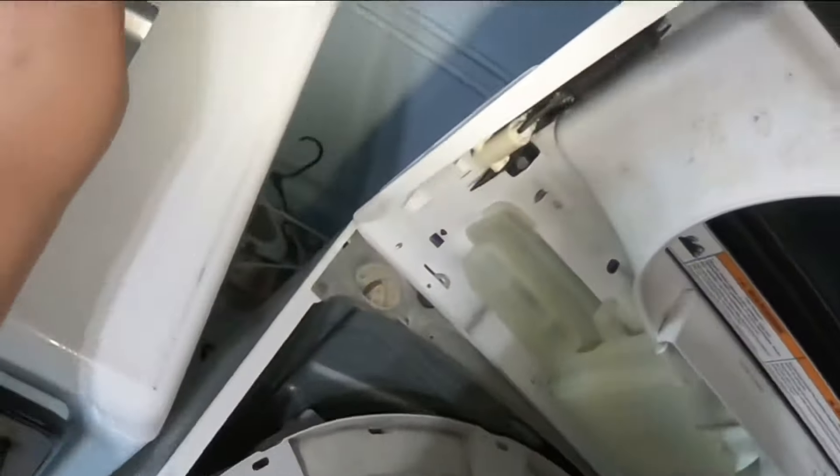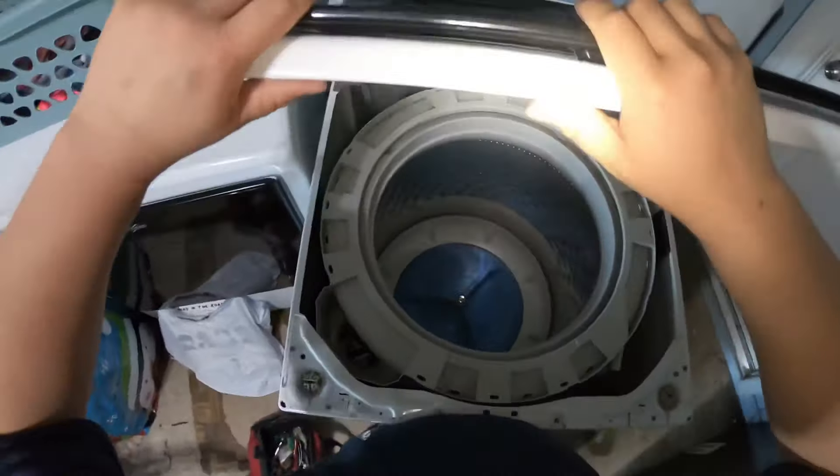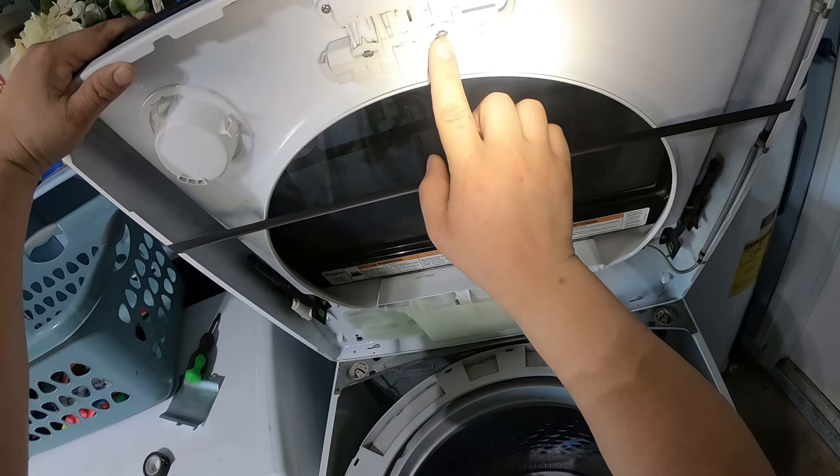On the left side it's a little trickier because it has some kind of mechanism, so use a screwdriver there to release it. Now we're going to follow the wiring. There are two filler screws there — you're not going to remove those because it's not necessary if you're just replacing the switch.